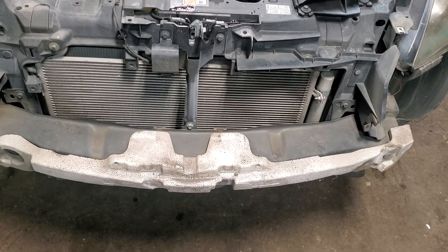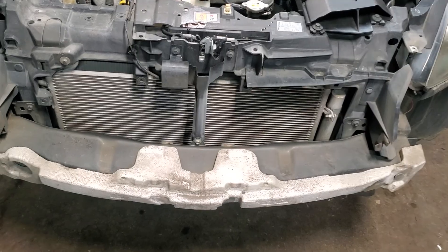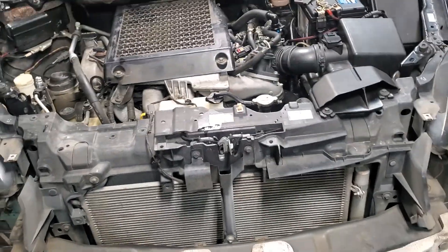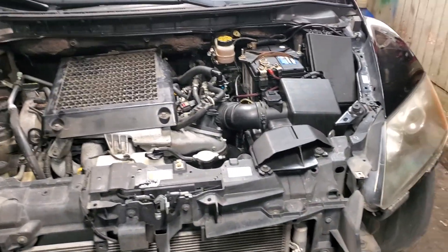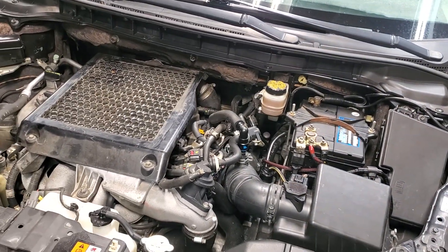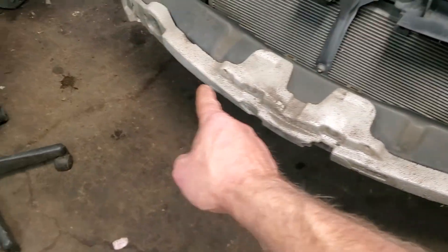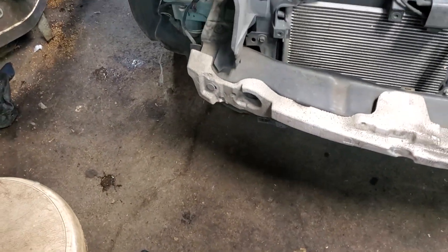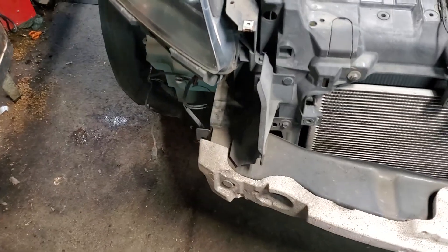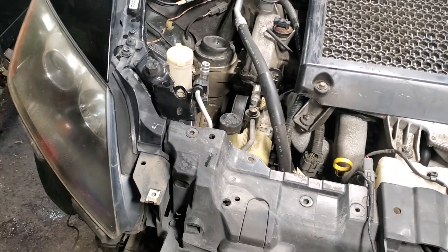You can do it like that — I do it like that — but not when it's freezing cold outside and I can do it inside. Doing it inside, you've got to do basically the same thing: remove all the same stuff. You've got to take the headlights out, the bumper support, the core support. Once you get that out, it's pretty much a straight shot and you can see the engine very easily.